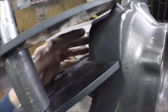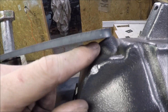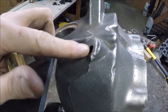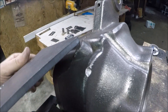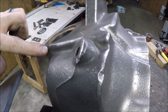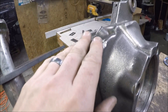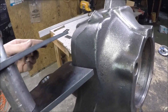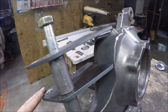I'm assuming the lower arm is supposed to fit up tight against the knuckle once I grind down some of that. Up top, it looks like there's a hole where an ABS line ran to — there was a bolt there — and I'm going to have to grind that down to make this sit flat across this ledge, which would be great for getting a good weld. So I'm going to grind a little bit at a time and keep test-fitting it until this thing fits nice and tight, then we can move on to welding.